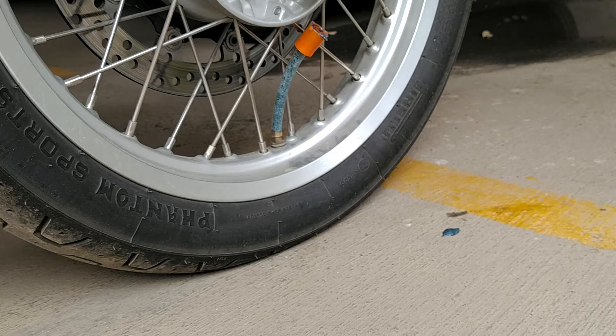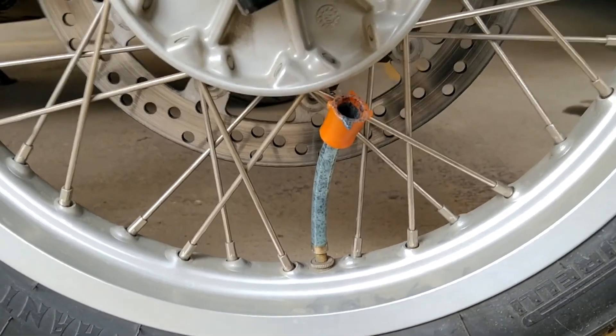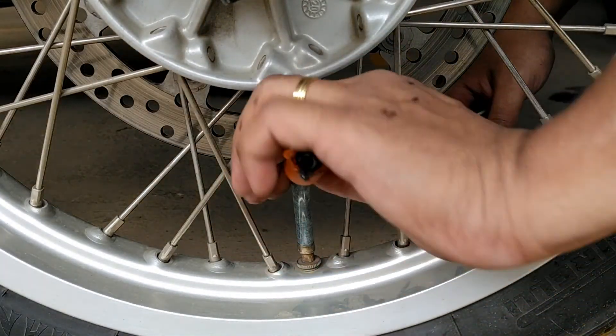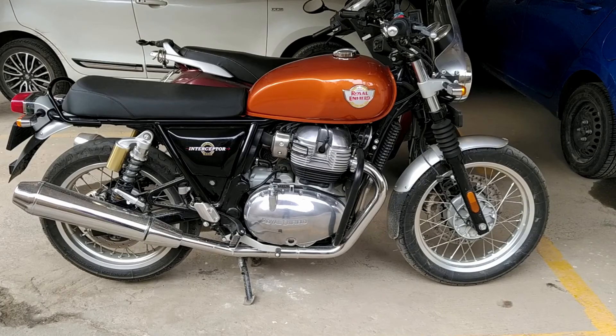It's a fairly easy process — don't be scared to put this in your tube tires or tubeless tires. The main things to ensure: first, do not lose the valve pin. Second, when fitting the valve pin, make sure it is not cross-threaded, because that would ruin the valve completely and you'd have to change the tube. Also, once you reach the fully tight point, just a quarter turn is enough — more than that will ruin your threads.